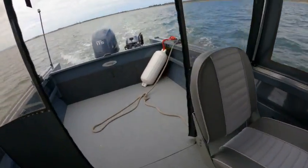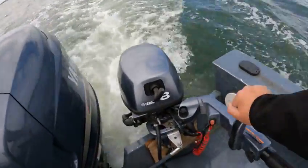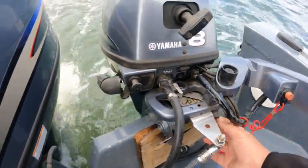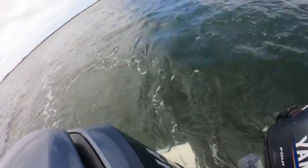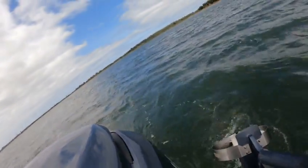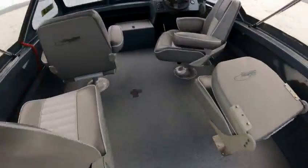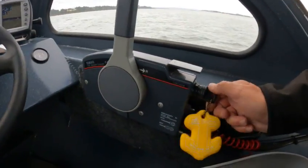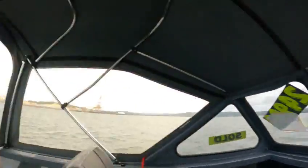So it's running really good. Bring it back to neutral, hit the kill button — you hit this switch right here — and then you lift this up here. Hold that, there you go. So that's working. Tilt the handle back, then go up here and fire this one up. Just turn the key on — everything on the boat works now.